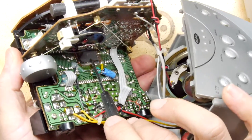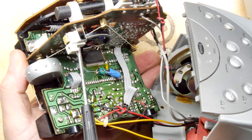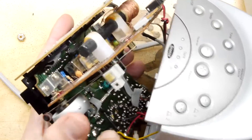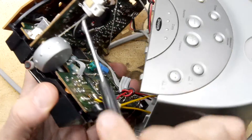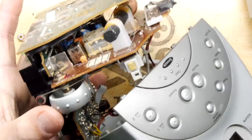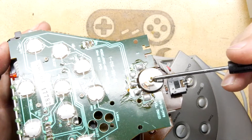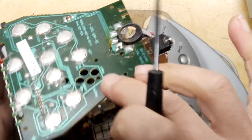There's an IC here that's been totally sanded down — they don't want you to know what they've done there. This is your AM/FM switch, and there's your tuning capacitor right in there; when you turn that knob it moves that capacitor. Everything else drives the little LED on the dial, which is kind of cute. There's also your AM antenna, and the various settings buttons and volume control on top with some nomenclature to examine.